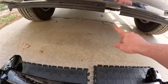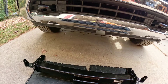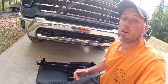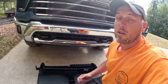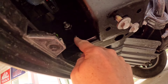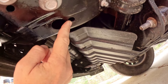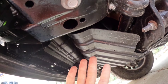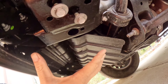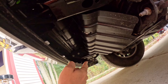That's all there is to it — you can see the notch we did right there. The only thing we've changed with this truck is we notched it and drilled a couple of holes in the frame rails on each side for the mounting bolts. There was a bumper cross bracket here that I took out just to give more room to access things. There's one bolt hole drilled up here, and we have another one drilled on the exact opposite side for the other side of the hook, and then one drilled for the rear hole. They do have this factory hole — that's what they call for plow mounts. We're not using that bracket kit approach, so I just have the holes on both sides, and that's how it mounts and supports this. It runs along in front of the splash guard with the same set of holes drilled on the other side.